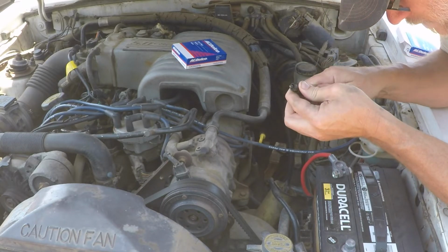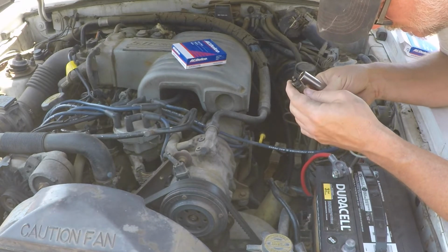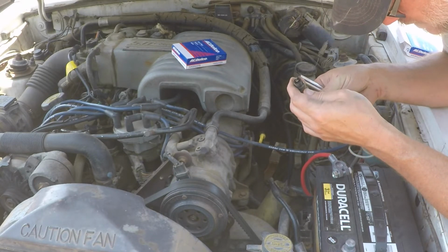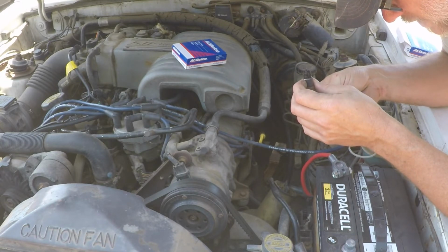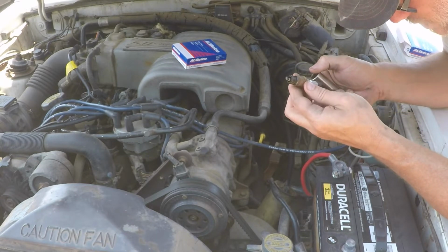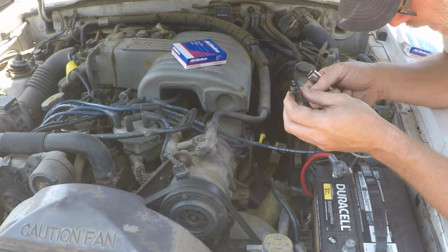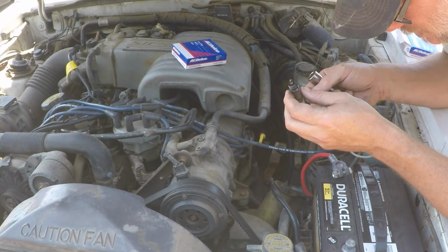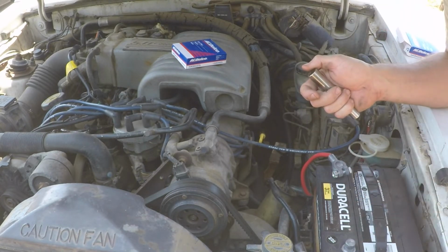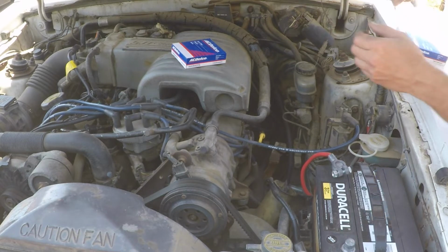Worn. Autolite Platinums, a little bit worn. Burn doesn't look terrible. It was a little bit on the rich side. Reading your plug is an important skill that you should do. You can look up exactly what you're looking for. Yeah, timing's good too. I better confirm that, but yeah, more knowledgeable people than I can give you a course on that.